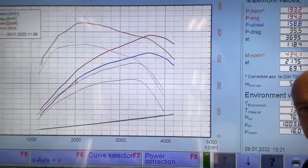We also carried out a static service regeneration of the DPF filter and then we custom tuned it. So we'll just load our tune graph up and show you it, and like we always do, we'll overlay it over the standard graph as well. So it made just around about 350 Nm of torque and 139 brake horsepower standard, and this is what we've got now.